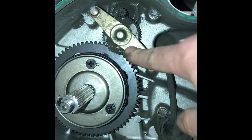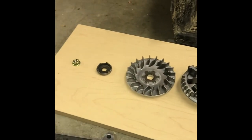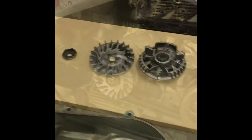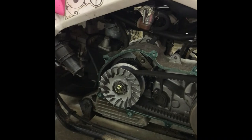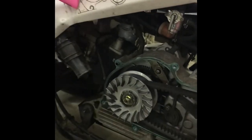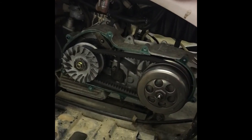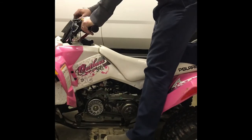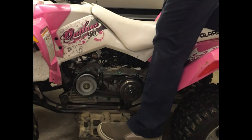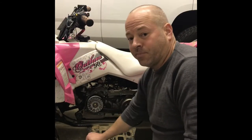I now have this piece back on, and in the same order I will put all these pieces of the clutch back together. I have everything reassembled and I did use a torque drill to get that nut on. We'll give it a shot and make sure it works properly before I put everything else back on. Then I'll just reverse the process and put all the cover plates on as well as the air cool hose and get this thing put back together.